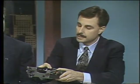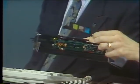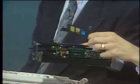And what's the difference in a black and white scan and a color scan there, Larry? Okay. A black and white scan takes the light as it comes off the image. A color scan uses a sequence of red, green, and blue filters to produce a 24-bit color image, much like a television uses a red, a green, and a blue gun to excite the right phosphors for a color image. All right, Serge, let's turn to you.